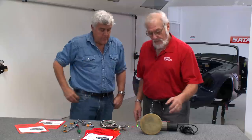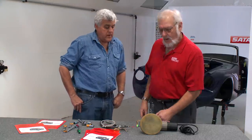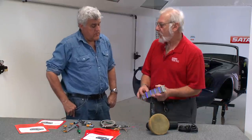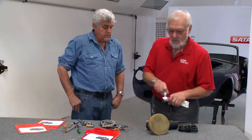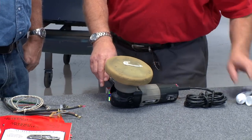Cool, what do you have? Well, first of all, if you have a plastic headlight cover, they turn grey and cloudy from ultraviolet. You can spend a lot of money and get a very expensive kit to clean it up, or you can use just a grinder at low speed and something that we should have around the house. Toothpaste — just a little tube of toothpaste. Put a little bit on the pad. And that works, huh? It's an abrasive. Yeah. You don't want to create heat.